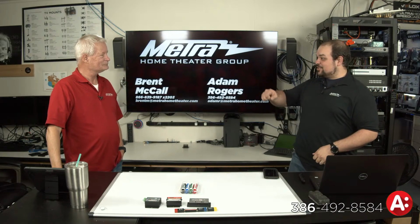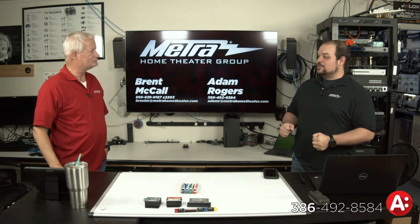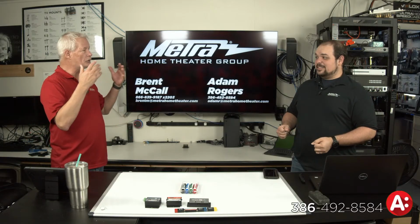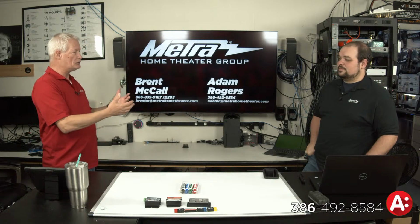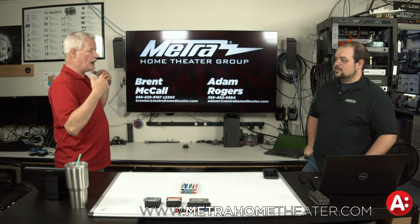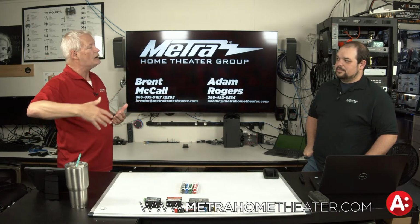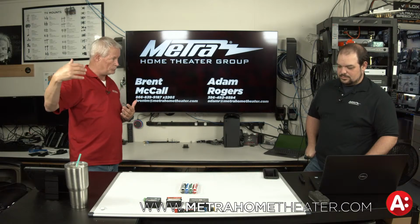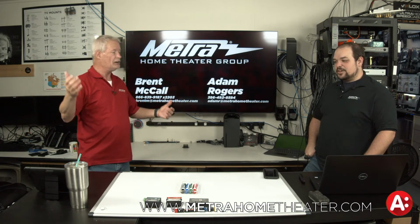But yeah, the Sony TV that we had, unfortunately, the HDMI inputs died on it. All of them died on it. And it doesn't always happen that way. It could be a single input dying. As you and I have discussed in multiple of our issues over the past year, cable boxes can send too much voltage to a display or a device and burn out a port. You plug in another one and it works. Yep. Till it doesn't. And then you move to another one.